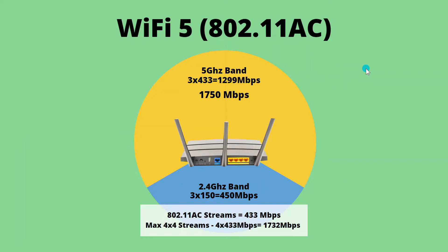Another thing people miss is that in order to get Wi-Fi 5 speeds, you need to have a Wi-Fi 5 device. So to get the most benefit from a Wi-Fi 5 router, you want a Wi-Fi 5 adapter or a device that supports Wi-Fi 5. In addition, if you want to connect more than one spatial stream at a time, that device also has to support MIMO or MU-MIMO. If you have a device connected to the 5 GHz band with only one spatial stream, you're going to get a maximum of 433 megabits per second — and after subtracting 30% for overhead, interference, and distance, that number will be a lot less.